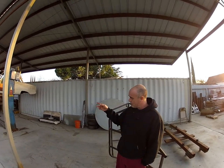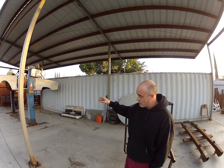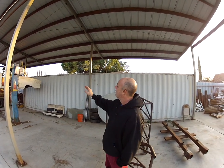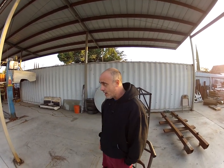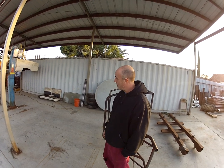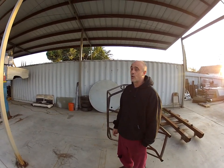Mm-hmm. The reason I wanted to do small tire and big tire on this, to get the instant center right so I could go back and forth and still get my instant center correct, is because of going out to these virgin roads. If you've got a virgin road, I'm going to run the big tires. And if you've got a road that's got a lot of rubber down, then we'll switch to the small tires, because the small tire is faster. Put the power down on the street, and the small tire will beat the big tire. Really? Yeah, because you don't have all that mass to get spinning. And if a small tire will hook up, you'll smoke them.